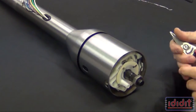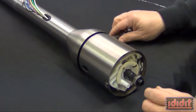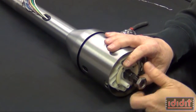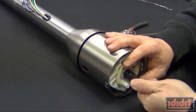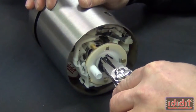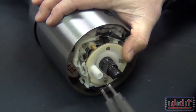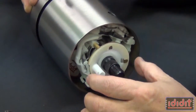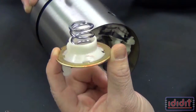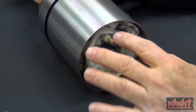There is a snap ring at the top of the column, right here. You'll need to remove the snap ring. First thing you're going to do is remove the nut off of the column. Then take your snap ring pliers and get right in there to get the snap ring out. It should pop out just like that, which will allow you to remove the snap ring, and the horn cam and the load spring should come with that as well. Now you can see the top of the harness with nothing in its way.